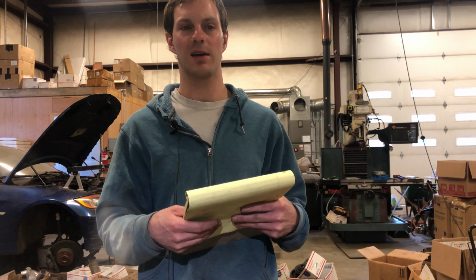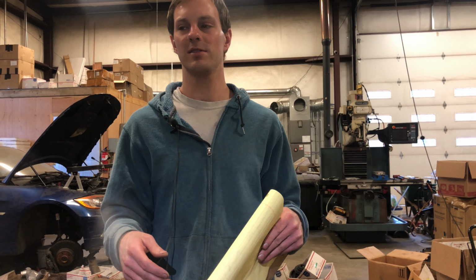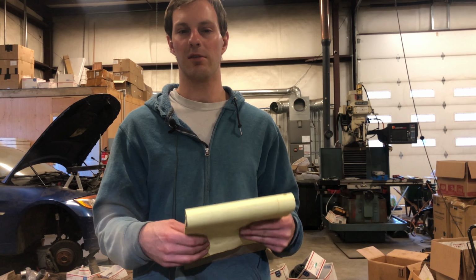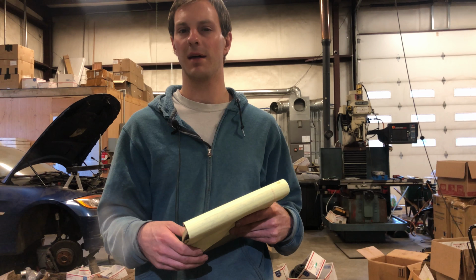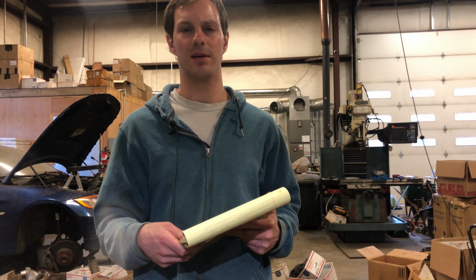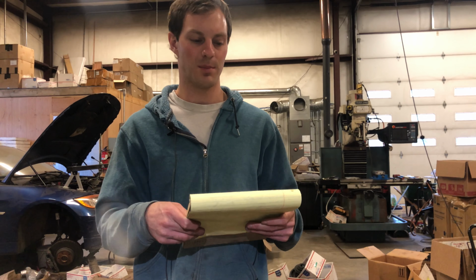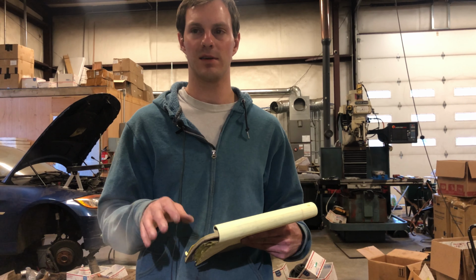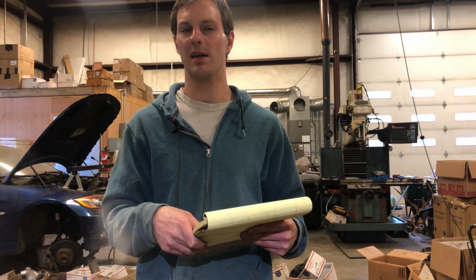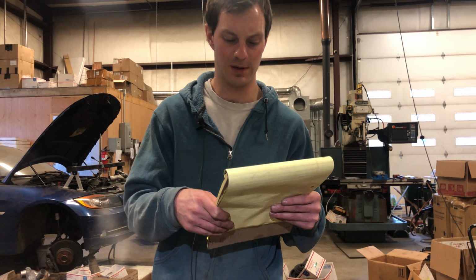In some ways, usually what would happen in that case, if it surged, most of the time it won't hurt the turbo, but if it was a very extreme case, it really can. There's only one time that I remember where a customer had accidentally run 52 pounds. He said it spiked for some reason. That turbo is only rated for 44, and based on looking at it, it looked like it had bent the shaft somehow, but it wasn't a catastrophic failure. It just looked like the shaft needed to be replaced.